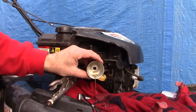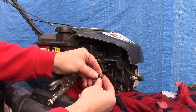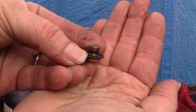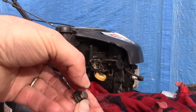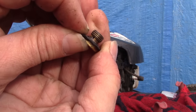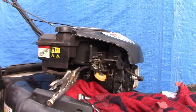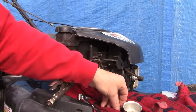See all that crud in there? All kinds of crud — we've got to clean that out. That's gumming up the main jet. Now on this particular Briggs and Stratton, the main jet is this bowl plug, the bowl nut. The fuel has to enter through the hole on the bottom and then come up through the top, and that's plugged with debris — there's no fuel flow getting through that. We need to clean out the orifices of this main jet as well as clean out this bowl. I think that's probably all we'll have to do to get this back up and running.